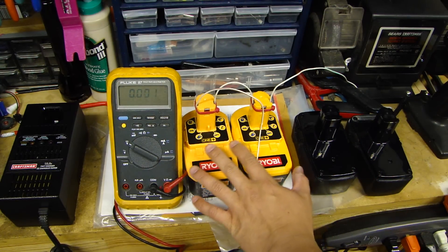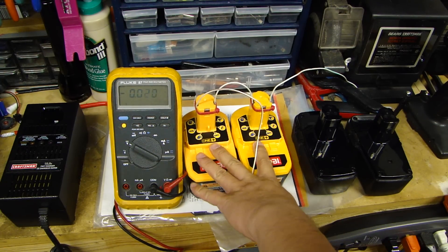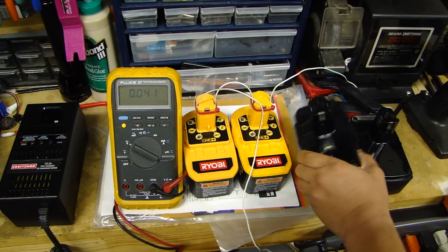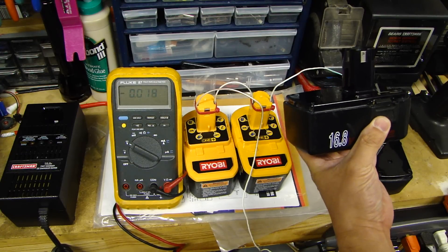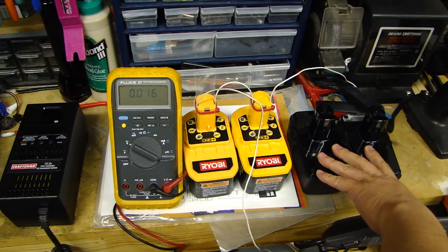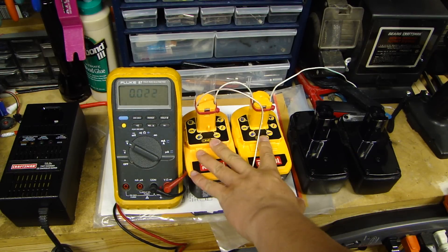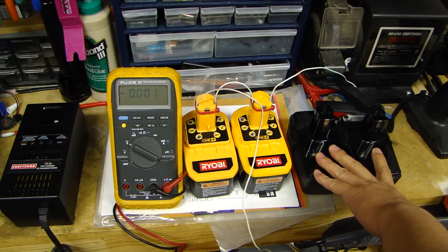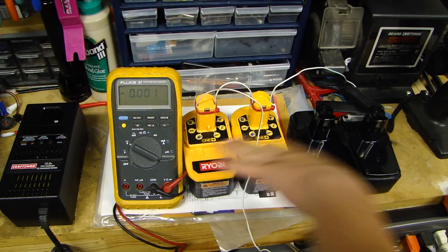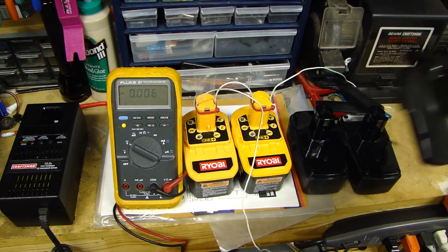After thinking for a bit I realized that I can actually use two of my existing Ryobi 18 volt batteries — these are NICAD — and use these two in series to jumpstart and rejuvenate these old Sears 16.8 volt batteries. I had to do this because these batteries are completely dead, about seven years old. That's another reason I went with Ryobi — after these ones died I put them aside, never used them, and started using my Ryobi tools. This is the Sears cordless drill I used with these NICAD batteries.